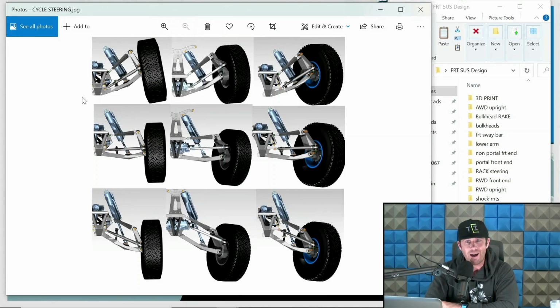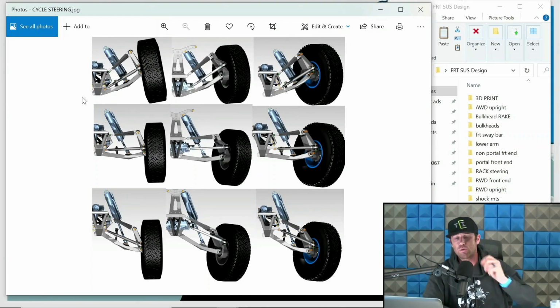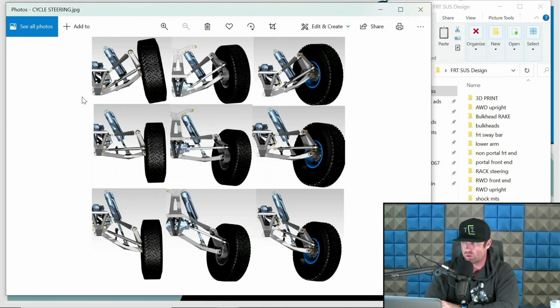Moving forward, there are going to be 5 aspects to the suspension travel and movement. At the top here is what I call compression. Compression is just that. The suspension is fully compressed. The middle would be considered ride height. There can be variations in ride height, and guys like to move ride height in the travel relative to compression. So they may have more compression or less compression relative to extension. Extension is the bottom side of travel, the bottom row, so to speak.